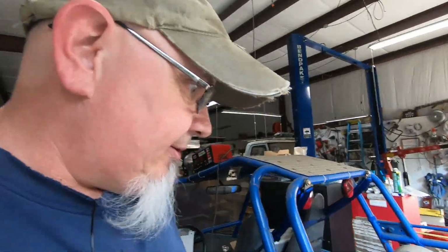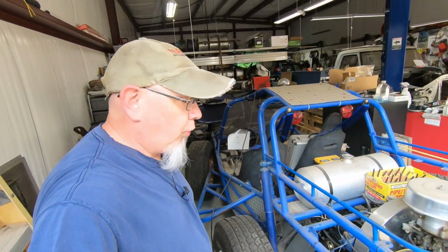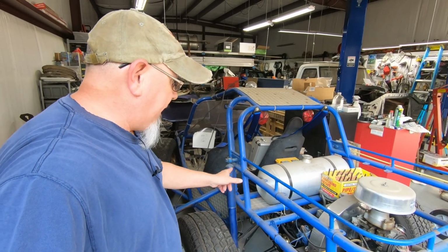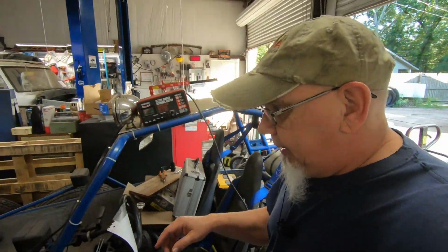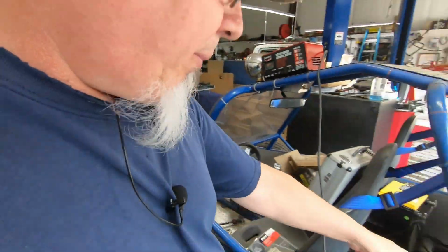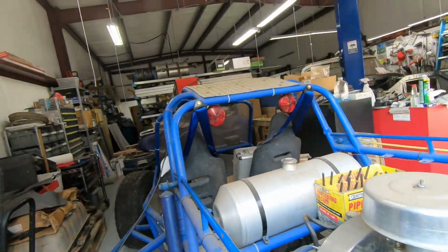All right guys, let's take a walk around this thing and see what we've got. This is a VW based rail buggy. Just run of the mill dune buggy like you used to see on the roads all the time. This is a Beeline Pack Rat chassis, which is a very good chassis, pretty popular as far as I understand. But it's got a 31 10.50 tire on the back, and it just has some regular street tires from Walmart on the front. And it does have a bus transaxle in it. It's a three rib, has a Weber progressive carburetor on it.